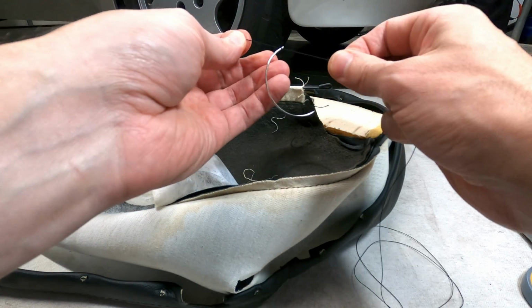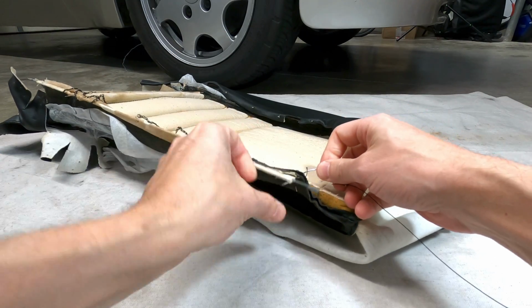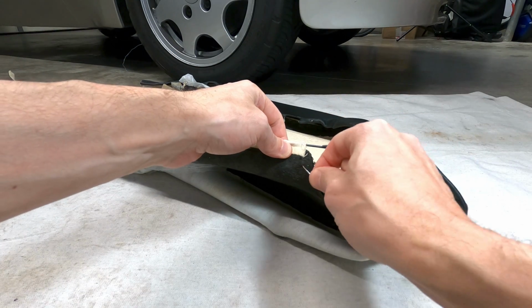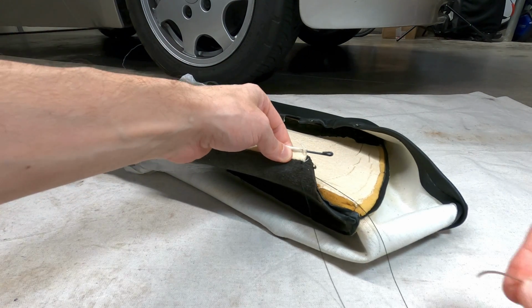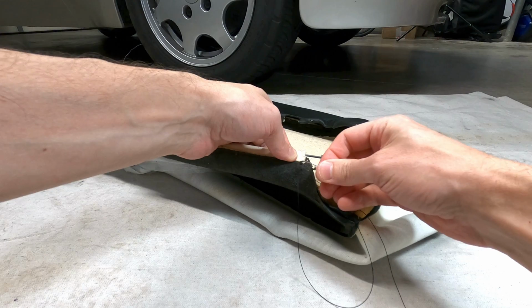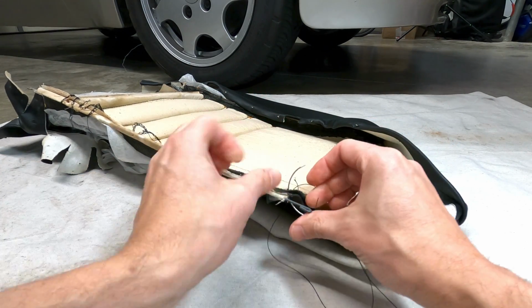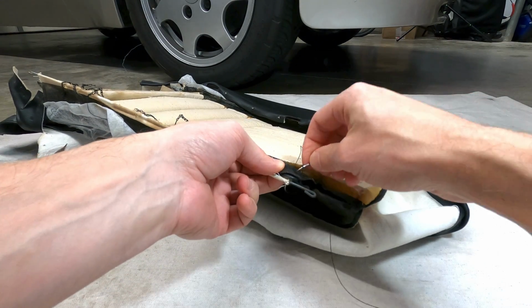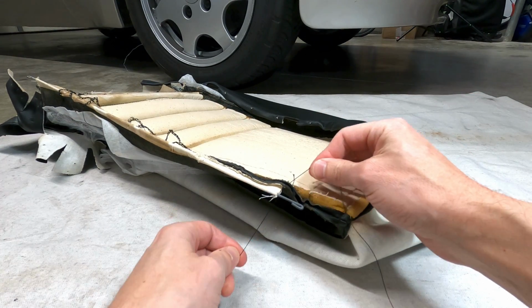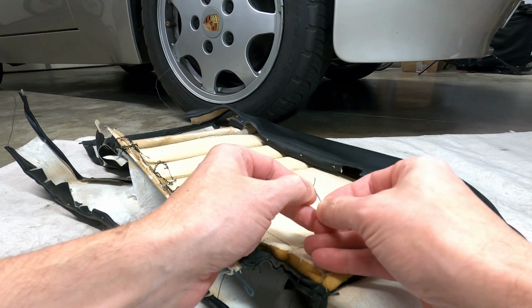To complete the straight stitch, we'll need a length of thread tied off on a curved repair needle. And we'll start by passing the needle and thread through one of the holes in an area of the seam that's still fully intact, pulling the thread about halfway through. We'll then move back one hole and pass the needle and thread through a second time. And finally pass the needle back through the original first hole and pull it tight, creating a nice loop to lock down the thread.